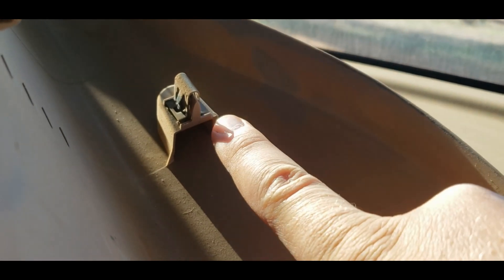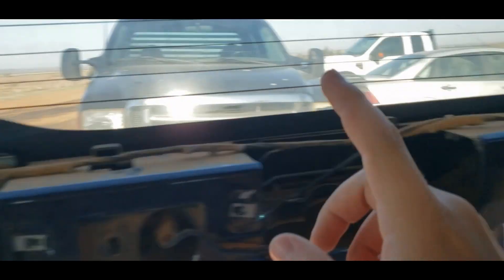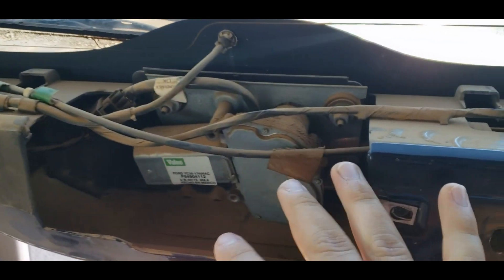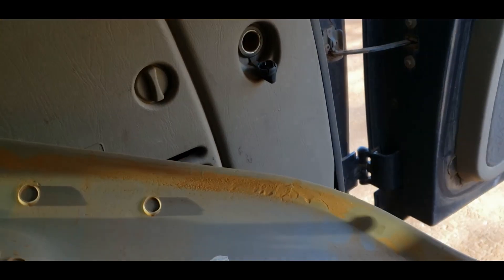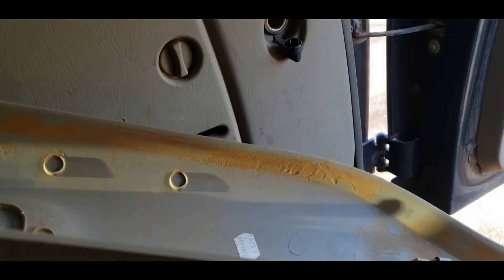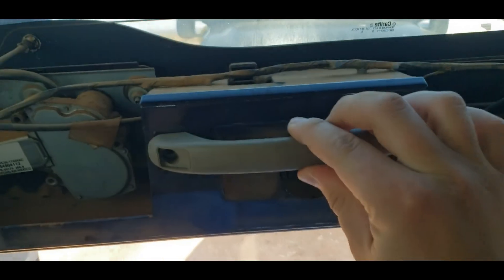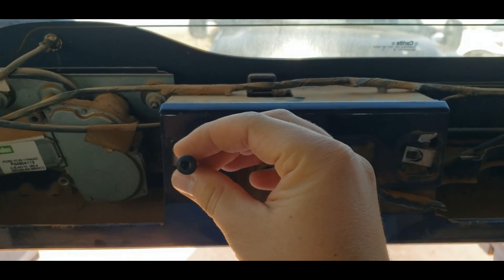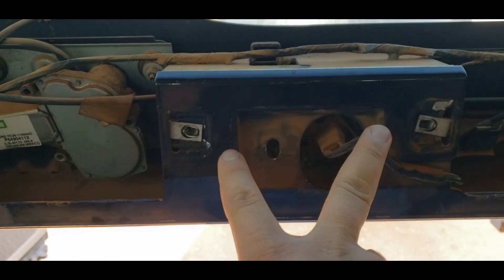It's got these hooks on it like so, and then it's also got these straight snaps that hold it in place here and here. The strikers — keep in mind — are on both sides of the door, and you have all your control cables and stuff that come right here. That's your rear wiper motor. You can still get the cables and whatnot as well. To get the trim off, you get it loose and then essentially gently pry it back and up to maneuver it out. Just be gentle with it — essentially pull it off but don't go crazy. You do need to remove this handle, which has a couple of screws and they are Torx — T30, probably — but get those off and pull the handle off. Then you can pull the trim. These are the only two screws that hold that trim piece on.